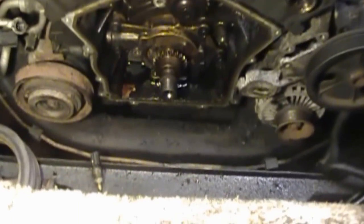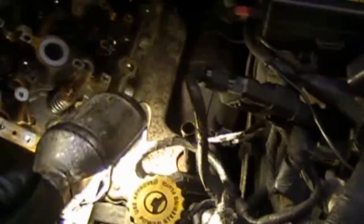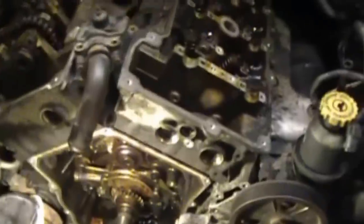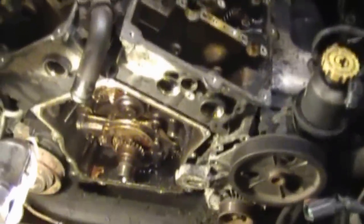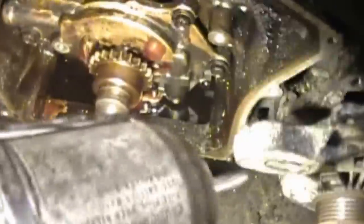Once you're down to there, you're pretty good. The only thing I'm going to do next is take the oil pan off. Although they say if you're going to take the oil pan off, loosen the motor mounts underneath on this side - don't take the bolts out on the driver's side - loosen the motor mounts and you can jack it up about three or four inches and the oil pan will slide out. Apparently there is a brace under there, an idler arm or something, that gets in the way. The oil looks pretty dirty but I didn't see anything unusual or much of a sludge problem.